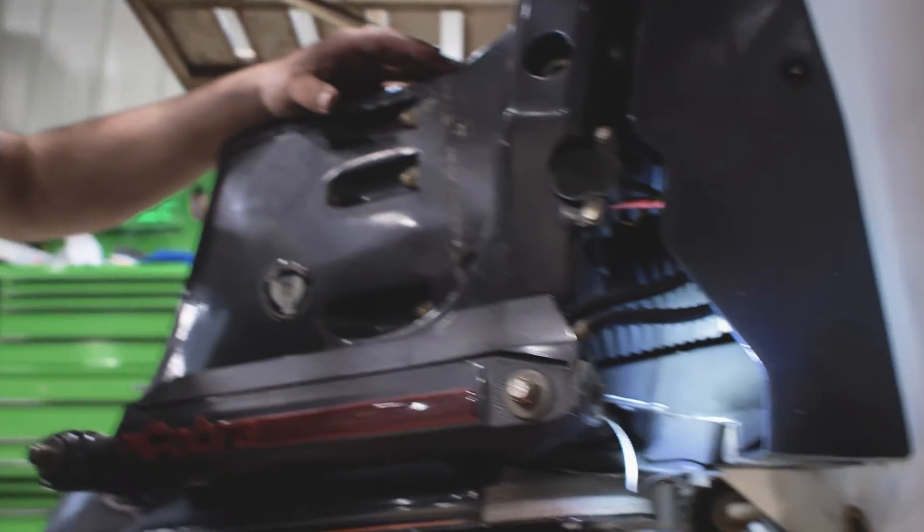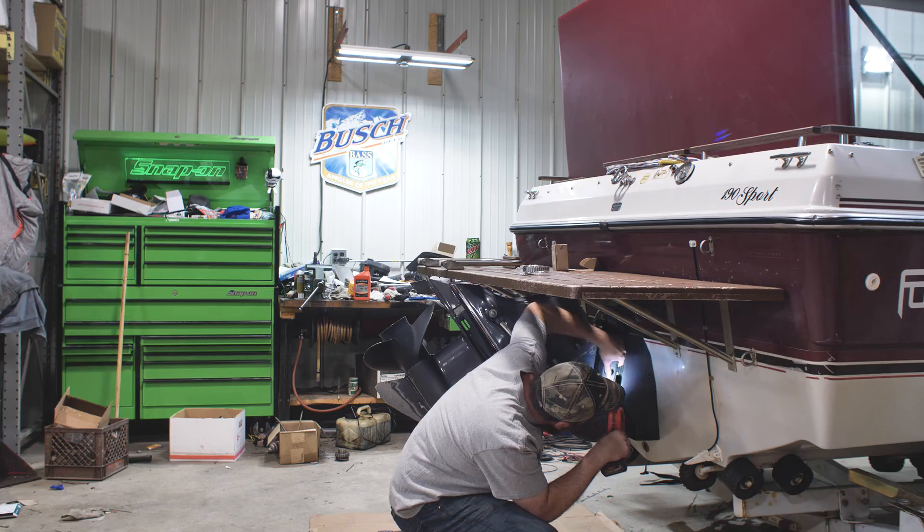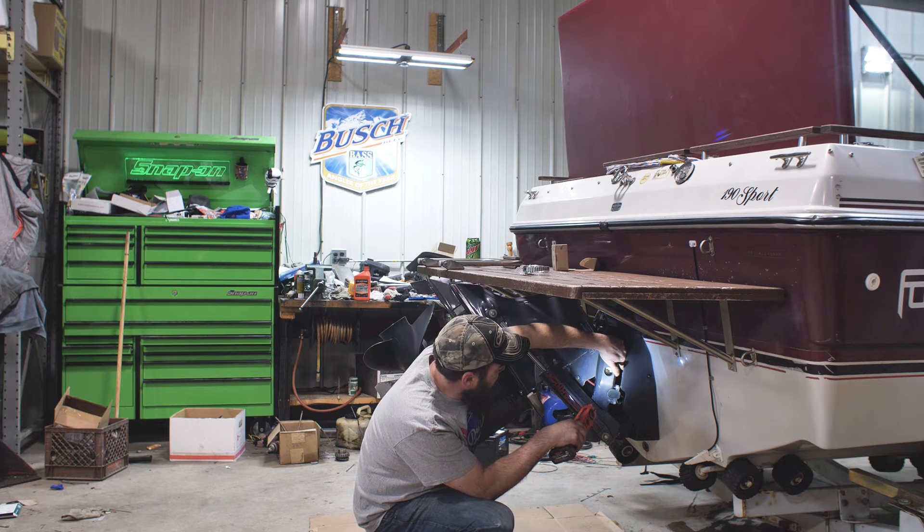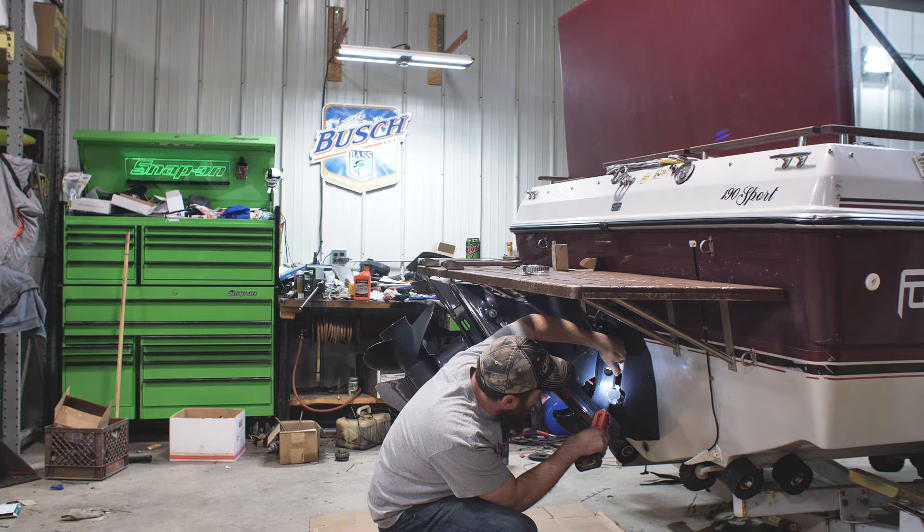You also want to take a look inside at your u-joint bellows on a fairly regular basis to see if you have dry rotting going on or a complete hole.